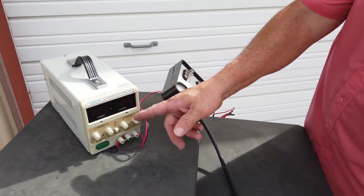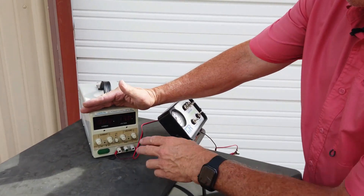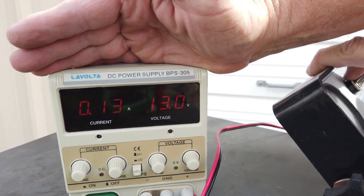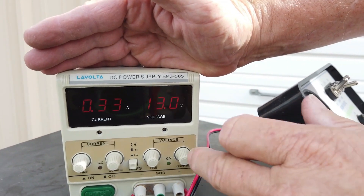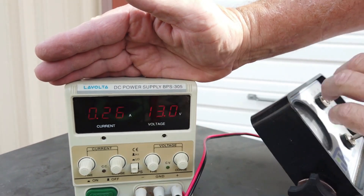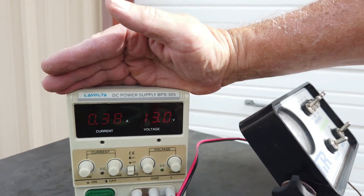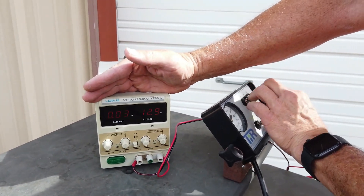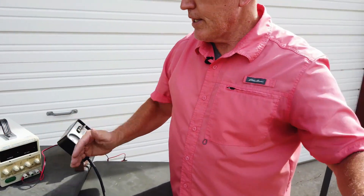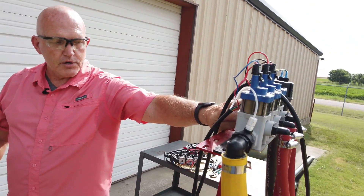In this case it's going to a power supply, so we'll simply turn it on. I've got 13 volts. Testing the valves now — you should see the current come on. The e-chip drew a full one amp then dropped down to 0.13, then drew full amperage and dropped to 0.26, then full amperage again and now we're at 0.38 or 0.39, which is basically 0.13 times three valves. The advantage of the e-chip valve is it draws the full amperage for basically one second, then the amperage drops down, leaving the valve to run cooler.